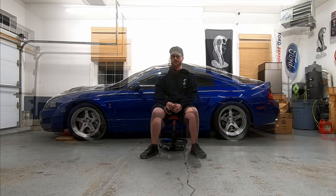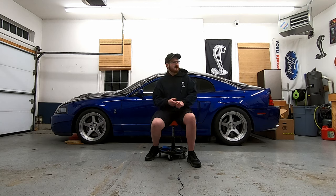The important question you have to answer first is: what are you expecting out of your car? If it's a daily driver, I wouldn't recommend camming it. If it's a weekend car and you still enjoy driving it, just make sure you know what you're getting into. If you go with some off-the-shelf Comp cams, yes it might be cheaper and it's going to sound really good, but you might not enjoy driving it because it's going to be more of a hassle. To some people that hassle is part of the car; to others it might make them drive it less and less.